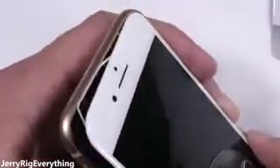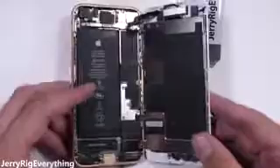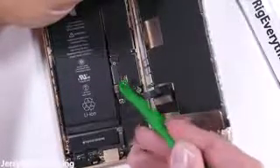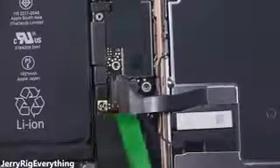Before the screen comes completely away, there's a series of clasps at the top of the screen. I'll wiggle the display down just a smidgen to clear those, and then fold it open like a book. Now that the screen is lifted away, we want to disconnect the battery. We'll find that connector under this metal plate with four normal Phillips head screws holding it down. Using my plastic pry tool to not short anything out, I'll unclip the battery connector like a little Lego, and then pop off the screen and home button ribbons — they unsnap like Legos as well.